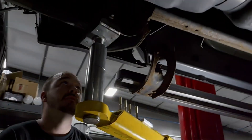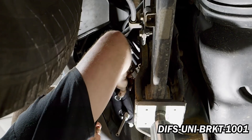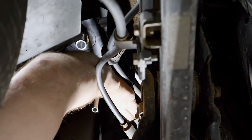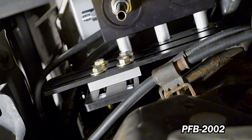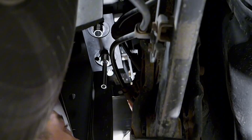Place the four 3/8-inch bolts through the supplied washer and DIFS-UNI-BRKT-1001 with the supplied aluminum spacer GMC-SPCR-1001. Place the bracket onto PFB-2002 using the four supplied locking nuts and tighten accordingly.